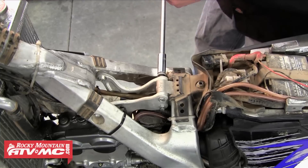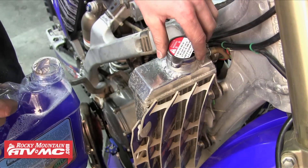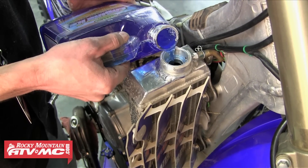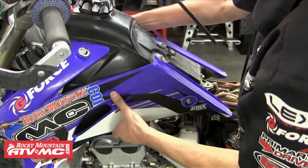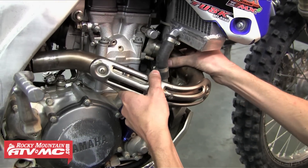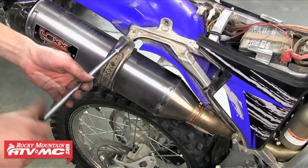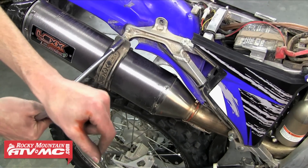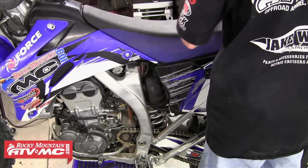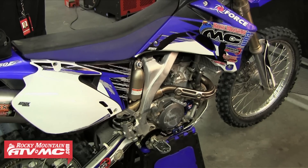After that we can reinstall both sides of the top motor mount and tighten those five bolts down. We need to refill the cooling system with coolant — we figured we'd do this before putting the tank back on to make it a little easier. Once we get that full we're just going to put the tank back on, tighten those bolts down, then reinstall the header, put the two nuts on front, tighten those bolts down, and reinstall the muffler. After the muffler's tightened down we can reinstall that side panel. Once the seat's installed we're done with the rebuild. Double check your work and make sure you got everything together correctly, and refer to your service manual for proper break-in instructions.